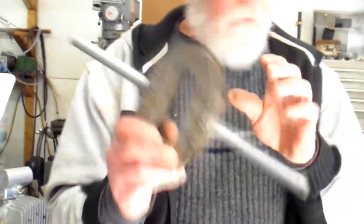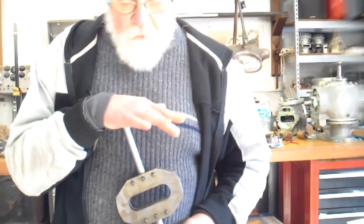The reason why this is good is because I can take this and put it in a press — there's no way around it, you can put a lot of pressure on that. Now, on a connecting rod regularly, your rod is going to be off-center like this. When you push on it, you're getting a side load this way. And this is what happens when you get too much side loading — you'll hear it inside your engine, rattling and breaking down, and then you're going to get scuff marks.